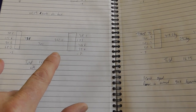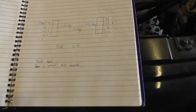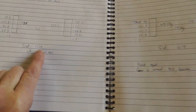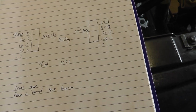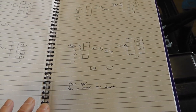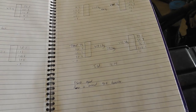As far as I can tell, the two sides of the car should have been pretty much the same, and there was a 30-odd kilogram difference on the other side too, so they're not exact. But they're not a million miles away either. The total for the standard Freelander came out at 1588 kilos — approximately what it should be according to the internet — and 1679 kilos for the EV Freelander. It's really only a 90 kilo difference. All the numbers were obtained using the same method, so they should be fairly close — within 50 kilos, maybe even within about 20 kilos.